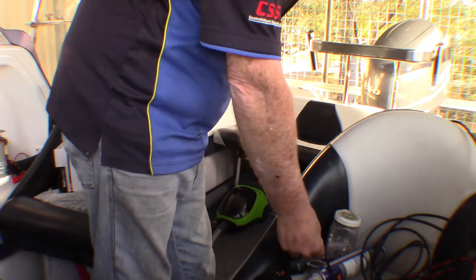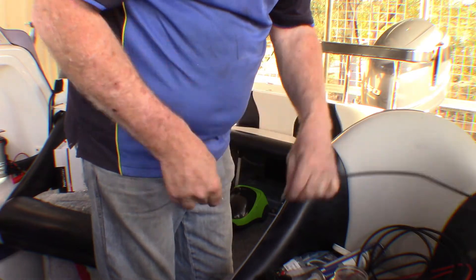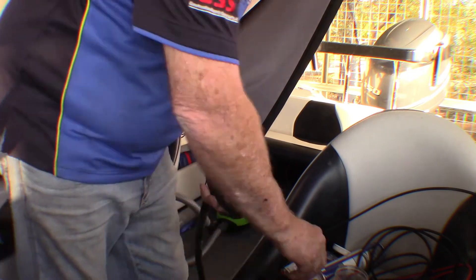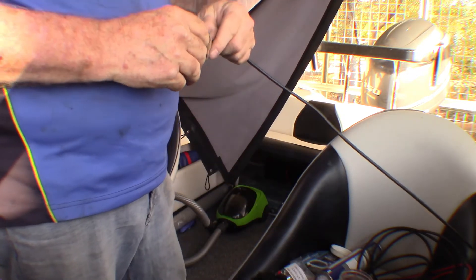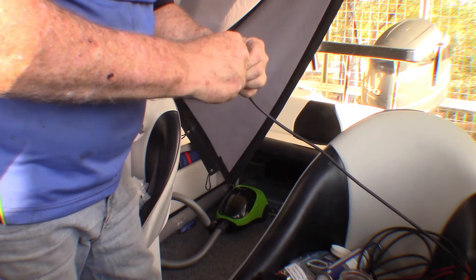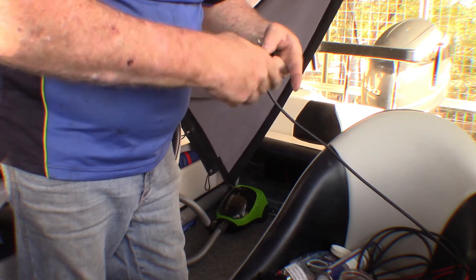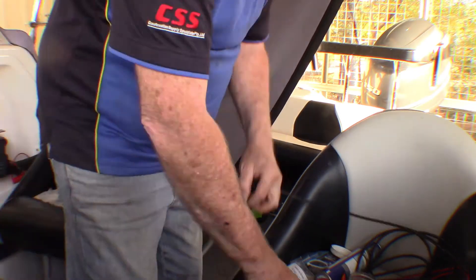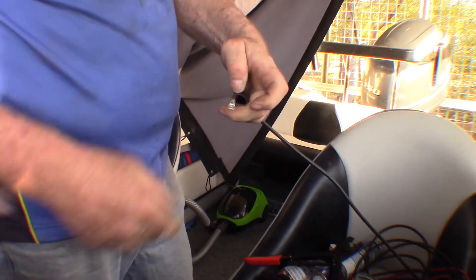I'm just going to set up the earth wire here to connect the 24 volt battery across to the 12 volt banks. Just checking that the bolt hole is big enough in this terminal — yes, it's a good size. I should put a bit of heat shrink on there first. This heat shrink's a bit big but it's what I've got so it'll have to do. This heat shrink has got an epoxy glue inside it so when it shrinks down the epoxy melts and forms a watertight seal. One of those wires came out at the top, so give it another twist and use a different set of crimpers. Give it a real good tug to make sure that won't come off.